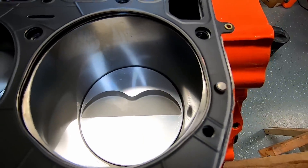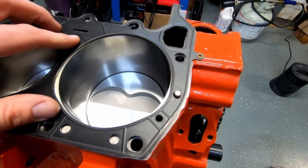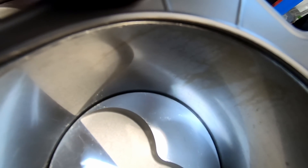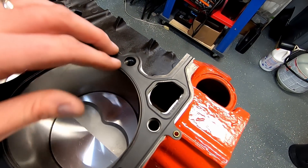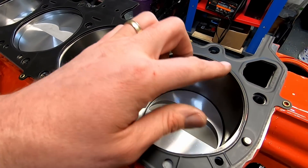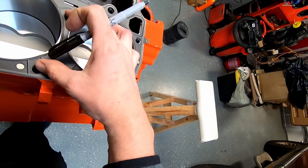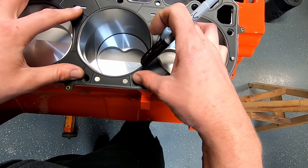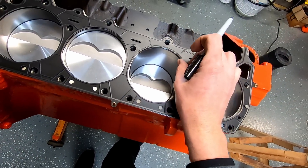You can flip this gasket either way — there's no top or bottom. So being sure the gasket does not hang over into the cylinder. If you're nervous at all, buy it a little bit larger. See that shininess on the edge by my finger? This gasket is good to go, but I have to check it all the way around on every single cylinder. What that looks like is holding it down flush and walking around looking at that very edge to be sure there's no hangover.